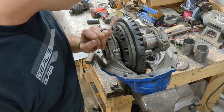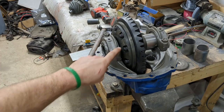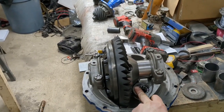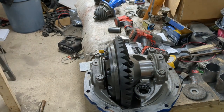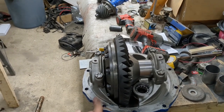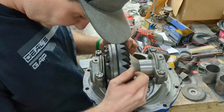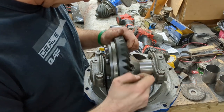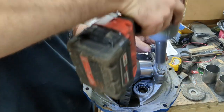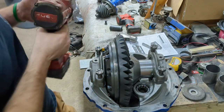Here's the issue we're running into right now: the bolt heads are hitting here on the inside of the case, but the carrier is also hitting here. So it clearly has to get shimmed or adjusted over this way, but not with the bolt heads hitting. I'm going to rock stuff back and forth for a minute, then take this back apart and see where everything was hitting.